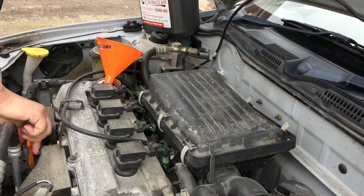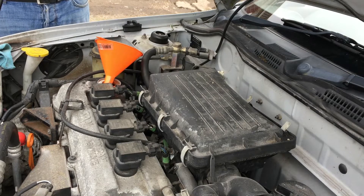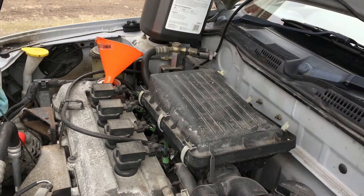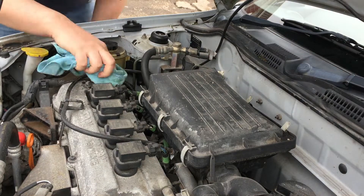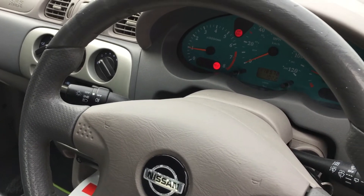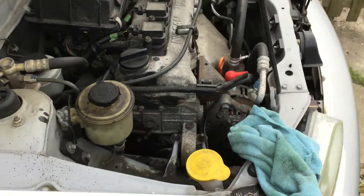I put in the Fuzz Townsend oil — a 10W40 semi-synthetic which is ideal for this engine. It says it's designed for hot hatchbacks of the 80s and 90s. Well, the Micra does have an advanced 16-valve power plant, so you could argue it's a hot hatch — it isn't, but anyway. After topping up the oil, the next thing is to start the car and make sure the oil pressure light goes out.